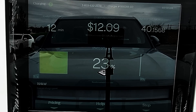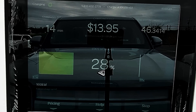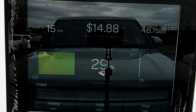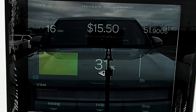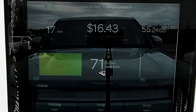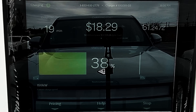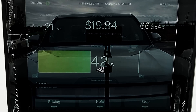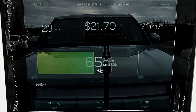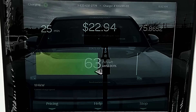That's when the R1T starts limiting power. Five minutes later, after 15 minutes of charging, we're at 29% state of charge and now taking in 170 kilowatt. After 20 minutes of charging, we're at 39% state of charge and the R1T is now accepting 162 kilowatt — still a very good charge rate, especially for a 400 volt battery system. Five minutes later the R1T is accepting 126 kilowatt and the vehicle is at 48% state of charge.